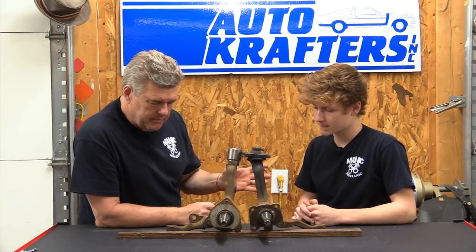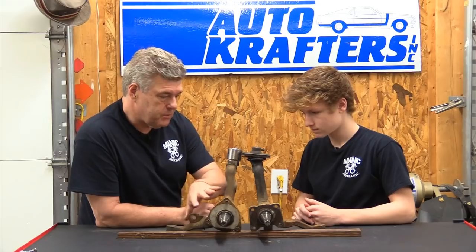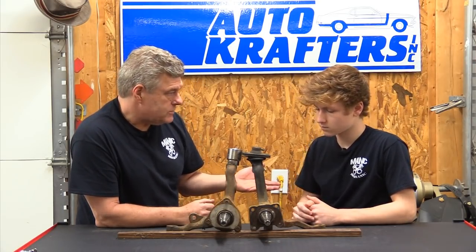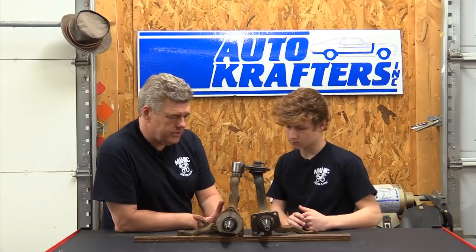You're kind of young into this, so it's not going to mean a lot to you, but the differences here are pretty extreme. Obviously this is a disc brake spindle because of the mounting positions on it, and this is a drum brake spindle. But there's a ton of different things that just make this a completely different animal — unsuitable for your Ranchero, 66 Mustang, 65 Mustang, Comet. Anything of those smaller body cars, 1965 on back to 63-64, and 66 on back on Mustang — this is not a good spindle.